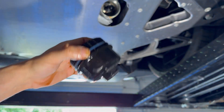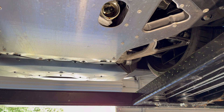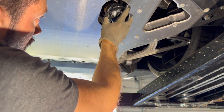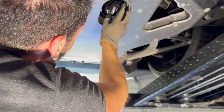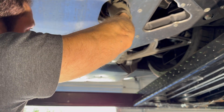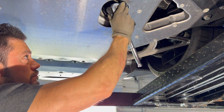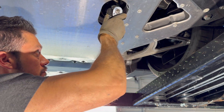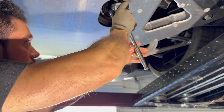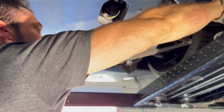Let's go ahead and get that put in and get the filter seated. The filter just clicks and pops in. Let's tighten it up. We'll get our torque wrench — this is going to be 18 foot-pounds. We'll torque all of them at the end at the same time. So let's drain the rest of the oil.